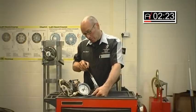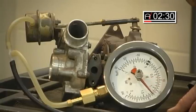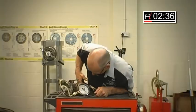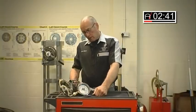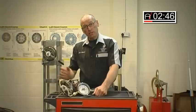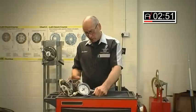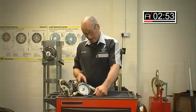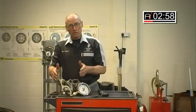Now I want to continue through the complete motion and measure when it's fully open, which is probably around there. And we've gone up to 2 bar. So I'm fairly happy that the movement of the rod is free, there's no rupture damage to the actual diaphragm, and it's operating through its range effectively. So that particular test is one we recommend, and that rules out any possibility of mechanical control errors.